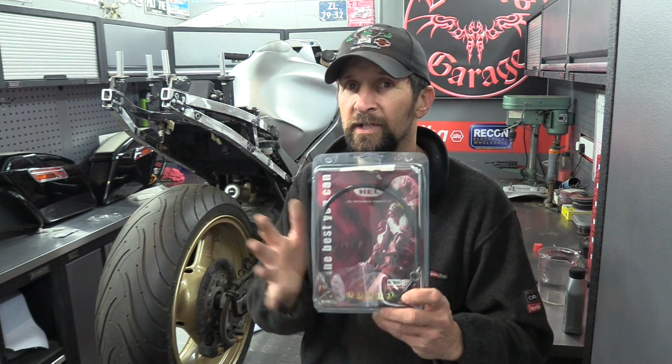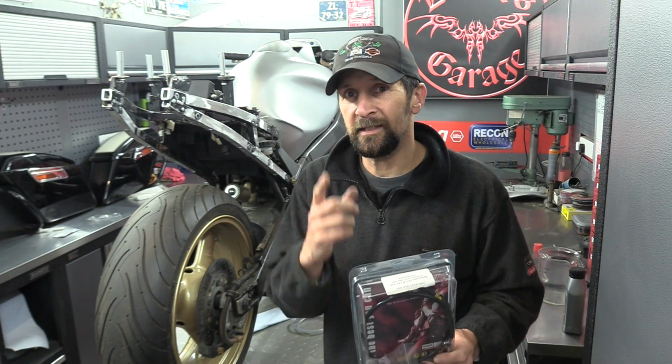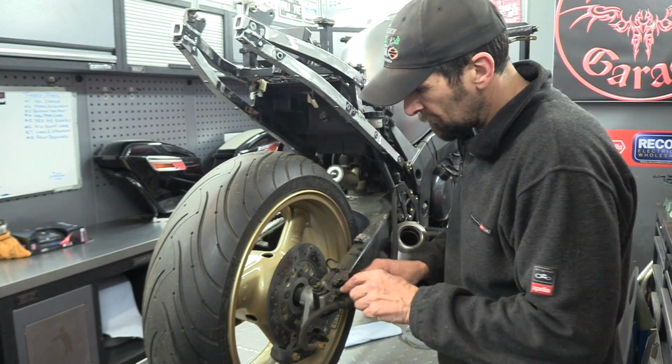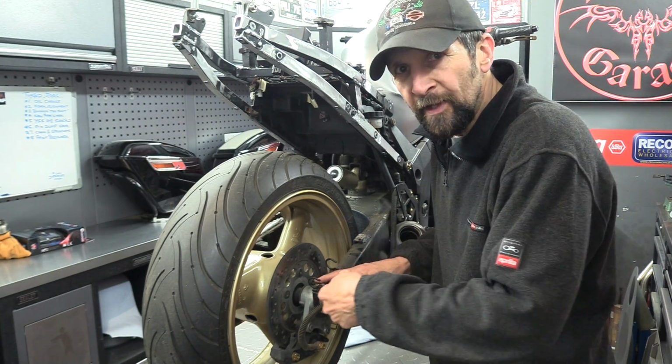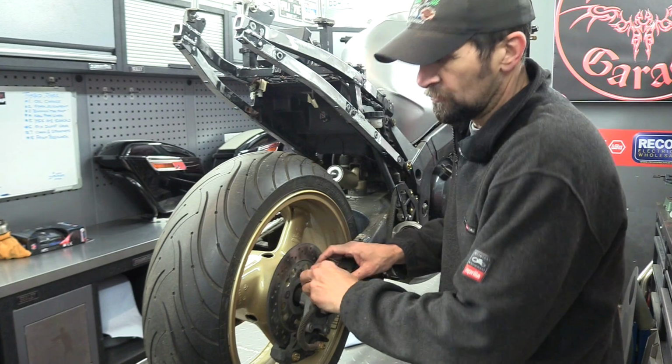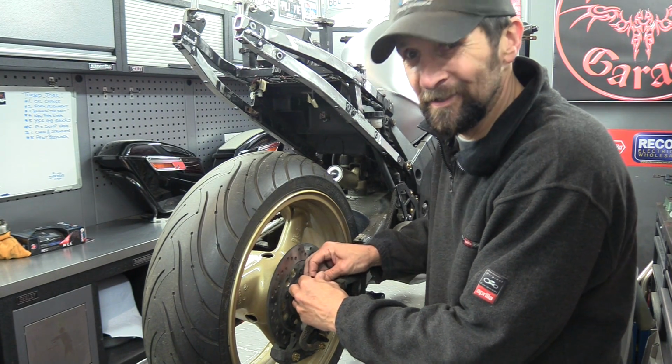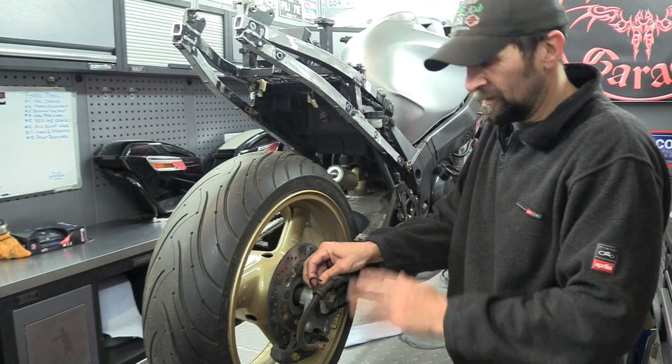Today, I just want to show you how to change a brake hose and bleed it up when it's bone dry, which is really tricky, not as easy as just chasing through the fluid, and this is the easiest way to do it possible. I'll show you how it's done. Right, first of all, take off the old one and drain the fluid out of it first. Water, if there's any water in it, drain it out too. And then get everything clean, ready to fit the new hose.